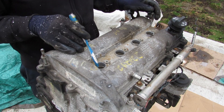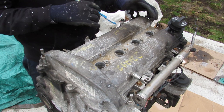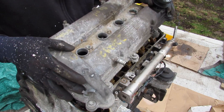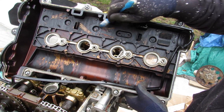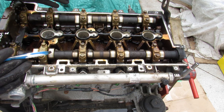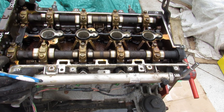At the top of the valve cover we have a coil-on-plug design because this is updated from the original design. I'm going to start the teardown by removing all the bolts going around the valve cover and lift it off. Now taking a look under this valve cover you can clearly see the intake and exhaust camshafts as well as the timing chains. There's nothing really special under here, although it's got a lot of carbon buildup.